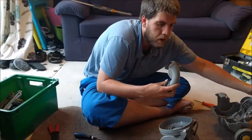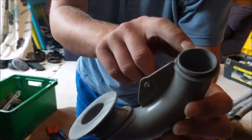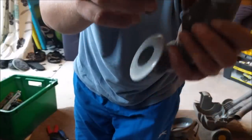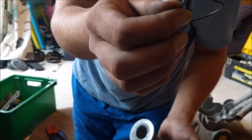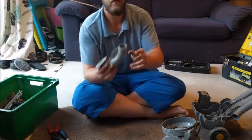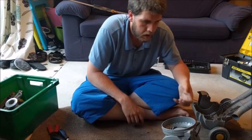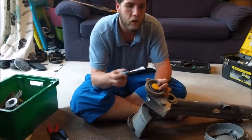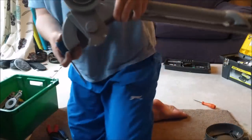Now I can show you a DC04 Achilles heel. Around here is a rubber seal — it suctions it to the cyclone — and the problem with this rubber seal is that it perishes. I rarely get ones that come out properly. You can't buy the rubber seal on its own, so when we reassemble it we'll stick a drop of glue around it and basically glue it to the chassis — it'll be fine. Before we get on to the motor, we need to take the wheels off. Pop the glamour cap off with a screwdriver, then there is a circlip holding the wheel on.